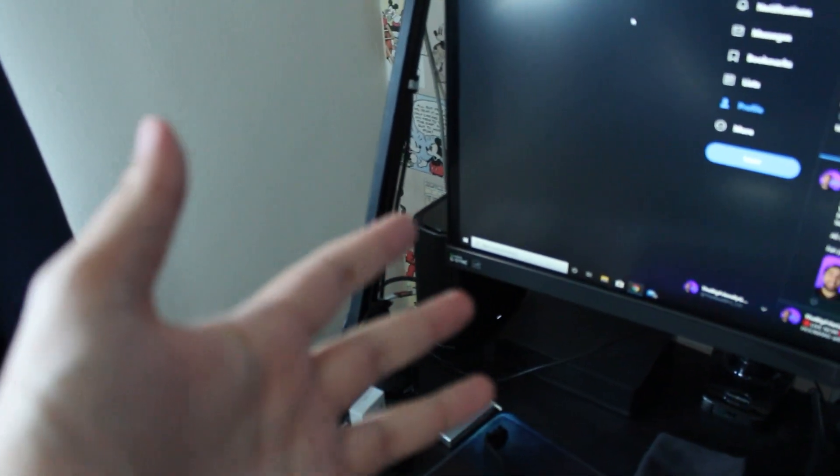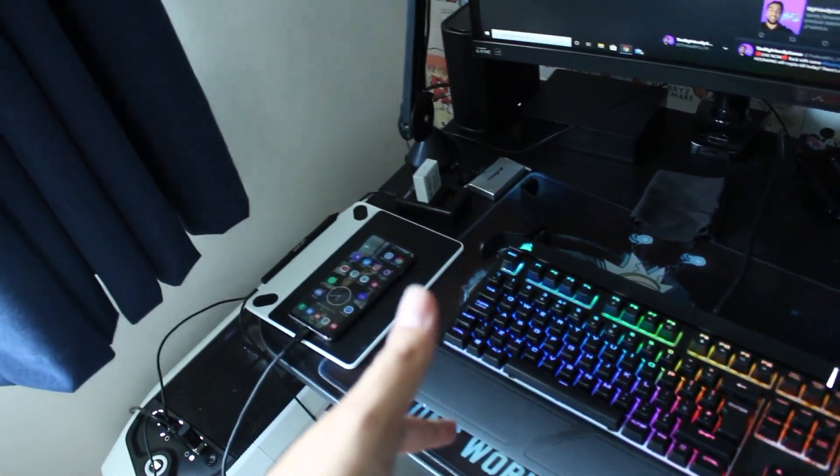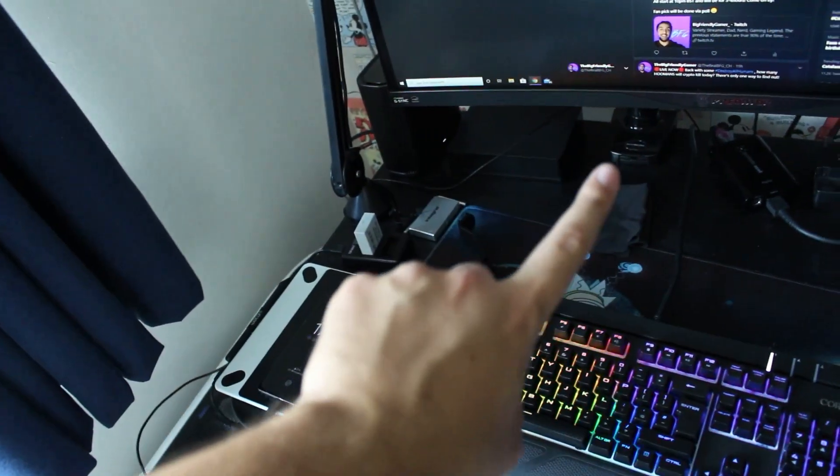It's been a while - we've come upstairs and put the second node on the desk for now. I was going to put it on the windowsill for better outdoor coverage but this will do for now. Everything's set up. We've gone through the app and upgraded the firmware on both nodes so they should be working perfectly. On the phone it's showing we're connected to Wi-Fi 6, which is exactly what we wanted. Now I just need to put the SuperHub 3 into modem mode and that should be it - then we can run more tests.